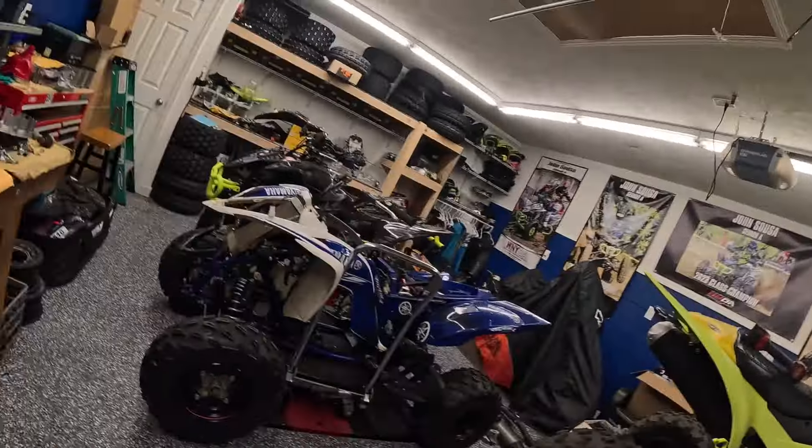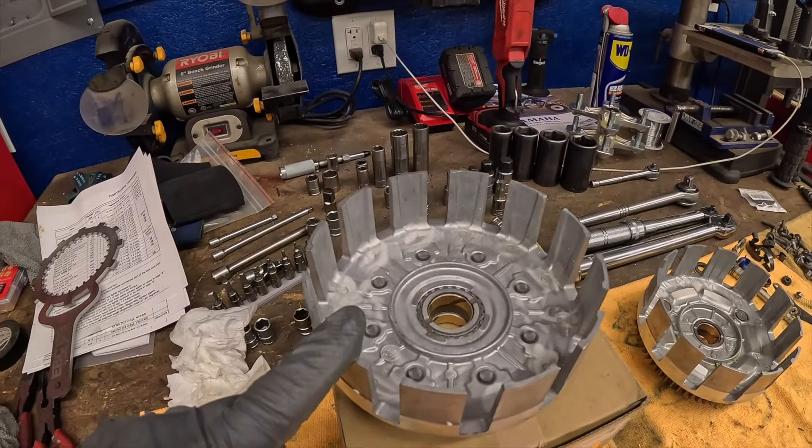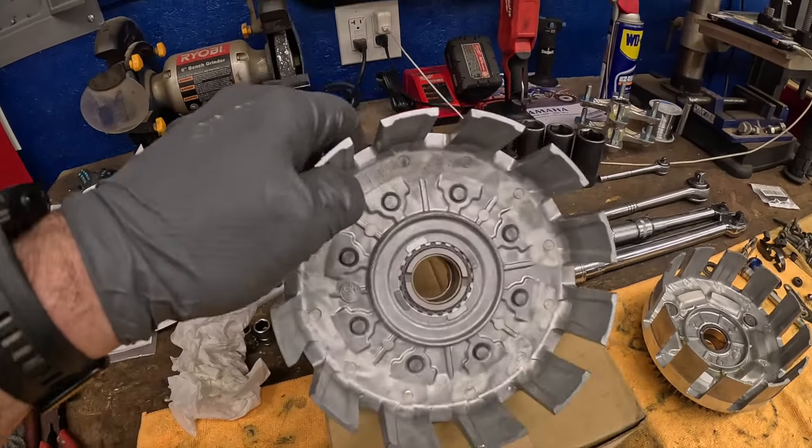The second video we're going to make after this one is replacing the flywheel bolts with grade 8 bolts — those have been known to snap. We do that to all our quads. Two things I think you guys really need to consider doing. So we are running the 2009 to 2010 YFZ450R clutch basket — this is the eight-rivet basket.